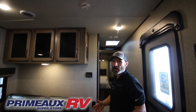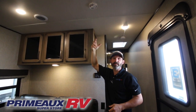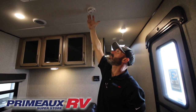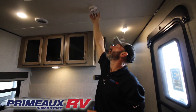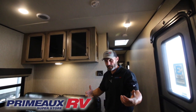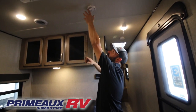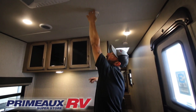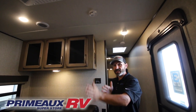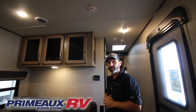If you're at a campground or somewhere where there's no cable and you need to use the antenna for the TV, what you're going to do is crank this reel till it stops. That means your antenna's all the way up. Then you're going to pull this down and turn the antenna till you catch the best reception. Whenever you're done, you're going to want to make sure that you turn this back and line up these 2 arrows and then crank it down, because it sits in the saddle. So if you're not lined up, it won't be sitting straight on your roof.